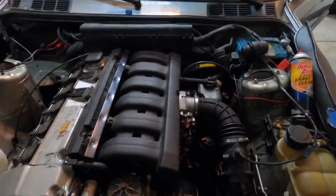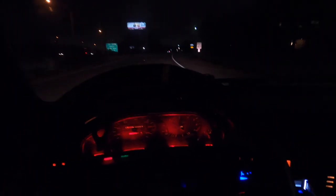We're cruising! I got my headset on. I've been getting out and checking the temp on the thermostat housing — it's not really going over 140, but it's 20 degrees out with no hood so that makes sense. I forgot to turn the heat on full blast during the coolant fill but I put it on full blast now and it's hot, which is good. It goes into all the gears. I need an exhaust — this is really stressful to drive without one. So far so good.